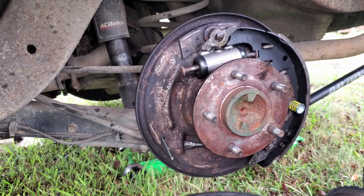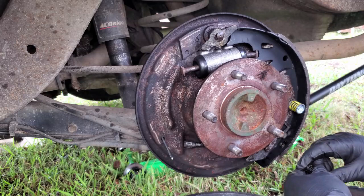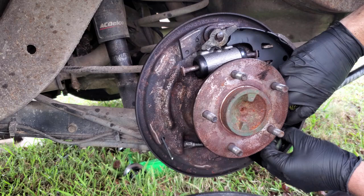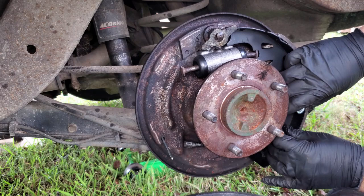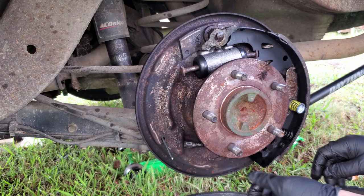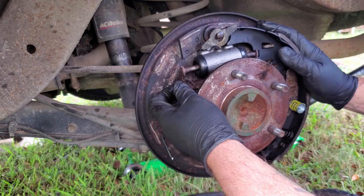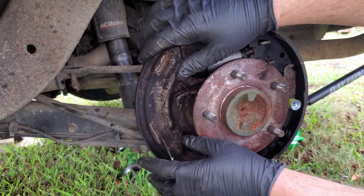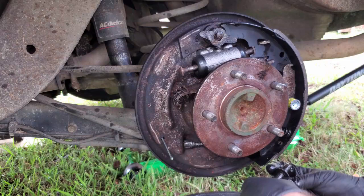The other wheel spring we need to put in there - they did not send a new one. That actually comes in the adjuster kit, so if you want a new star adjuster you gotta buy it separately. I forgot about that to be honest - I thought it came all as one, but it doesn't. We're gonna reuse it. The crossbar - spreader bar, whatever it's called - slide it in there. We got that on there. I'm gonna start working on putting this other side on. We still got our springs and our adjuster down here. Normally I like to hook one side of my spring and then kind of put my front pad up there - tends to work out pretty good.